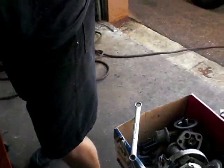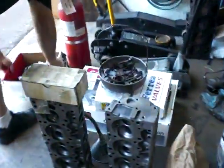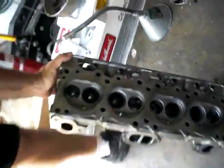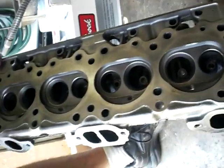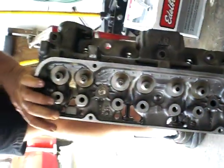It's going to be a nice piece, it's going to make good power. The cylinder heads — I just got them back from the machine shop, disassembled and completely glass beaded and cleaned. They're stock 6X4s, which are going to be completely ported and polished, all the casting flash removed, the oil galleys deburred, and all the guides are going to be cut down for seals because there are no seals from the factory.